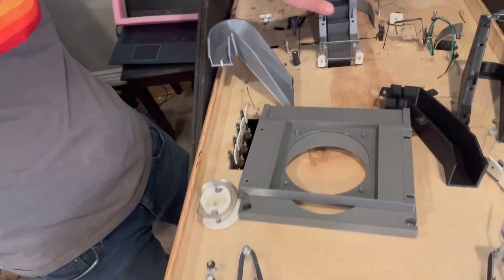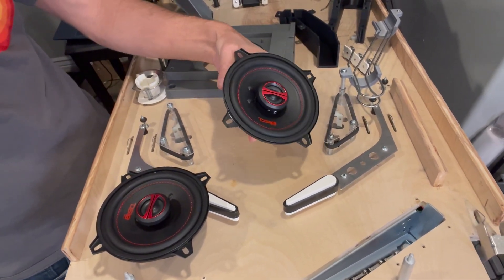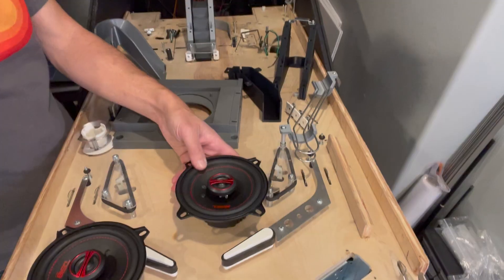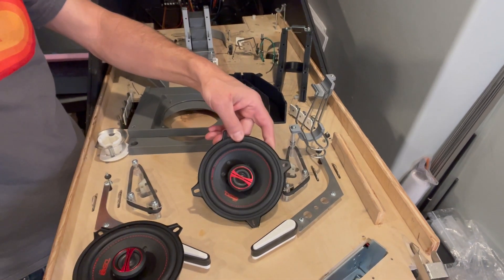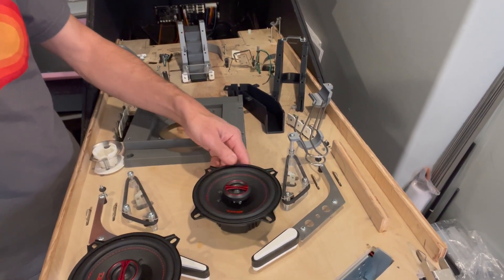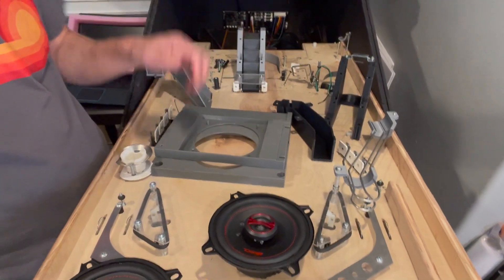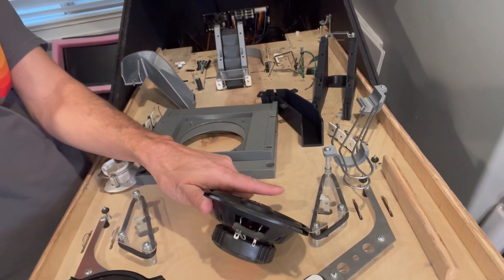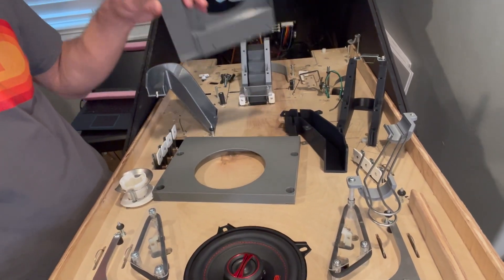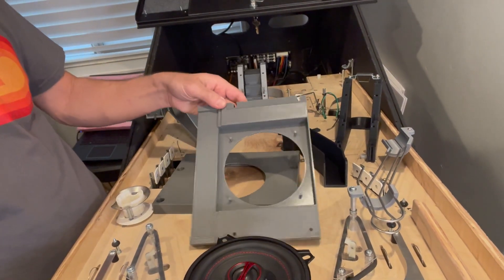Panning back out — we also got new speakers. After a couple of you pointed out that my speakers were just single mid-range and didn't have a tweeter, I got these DS18 coaxial speakers. They got pretty good reviews, can handle up to 135 watts max — nice two-way speakers. That should give me better range in the music. They're a little thicker profile though, so I had to redesign the brackets to be deeper so the speakers aren't being smashed against the grill and unable to actuate.